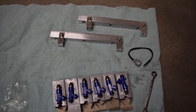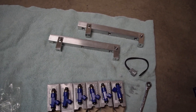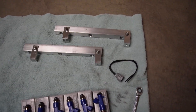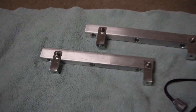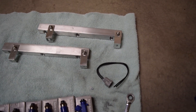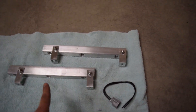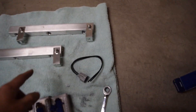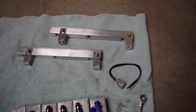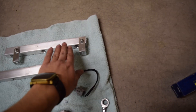Right now I have lines going from the trunk where the gas tank is all the way up to the engine bay. But because I had stock injectors in, I had to change it back to a barb type fitting and put that back into the fuel rail and go back out into the 6AN. So let me start you guys off with these — these are two billet fuel rails from PaulNet AllNet. You can find them on Facebook, I'll put a link in the description. These fuel rails fit the VG30.